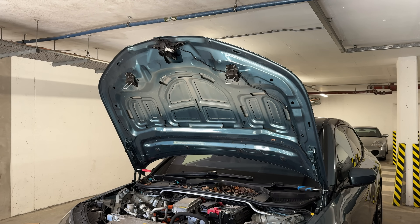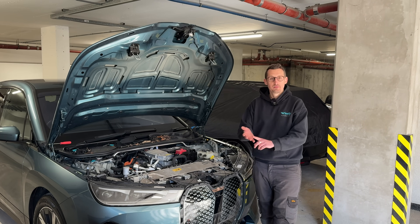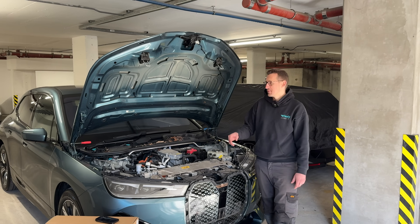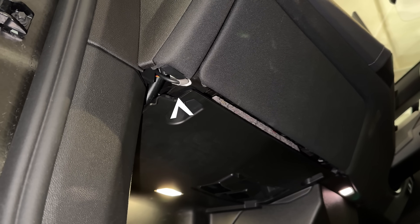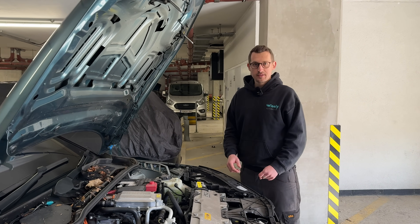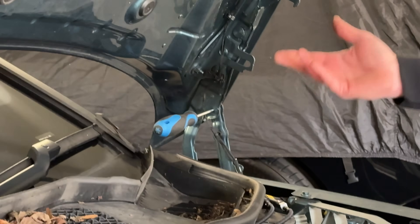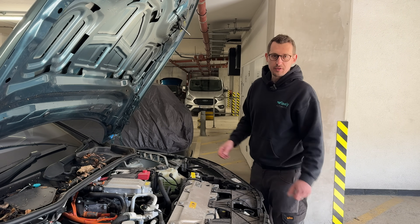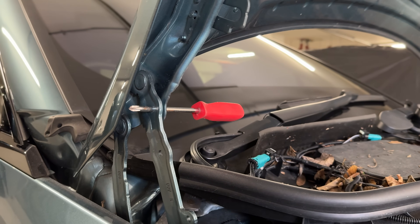On the subject of the bonnet - a bit like other iconic cars such as the Audi A2 and the BMW i8 - the bonnet on an iX is non-user-openable. You can open it and it's really not difficult at all; we'll overlay where the pull cords are. Once you've opened the bonnet the first surprise is there are no gas struts. In an effort to save weight, BMW have provided cleverly positioned holes and a special tool - really just a glorified rod - which lines up at the right height and holds everything safe so you can work under there.